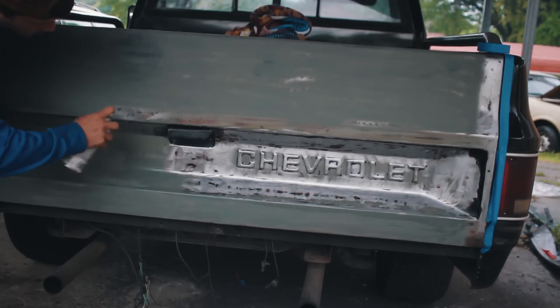I expect there were little rust spots that were painted over and they just continued to spread underneath the paint. Especially where the bondo was — if rust is underneath bondo, as time goes on it'll push the bondo off the car, which I think is what happened here. I ground all those down, got it all to bare metal. The places that were still a little pitted I put some rust reformer on — that's the black paint you saw me spray. The green primer is a self-etching primer that you put on top of bare metal. I'm going to prime the rest of the bed and then use a filler primer on top. I'm not going to use any bondo if I can help it. I don't mind little dings and dents because it'll match the rest of the truck — that's what I'm going for.